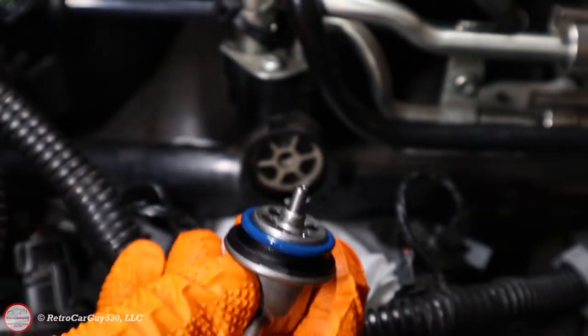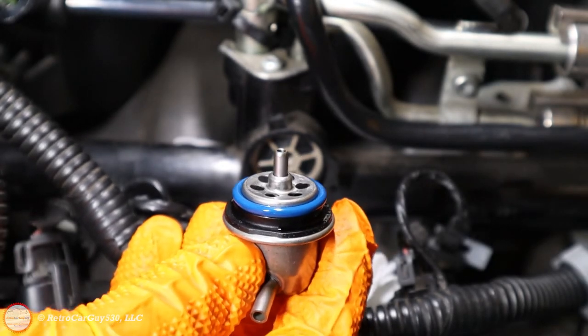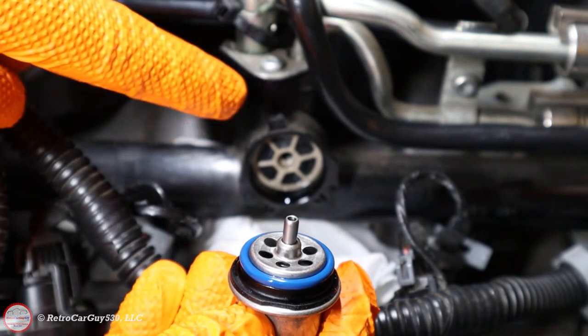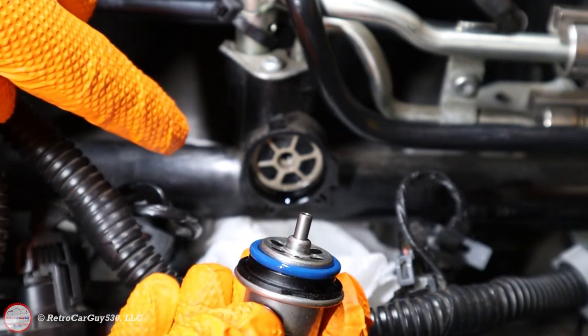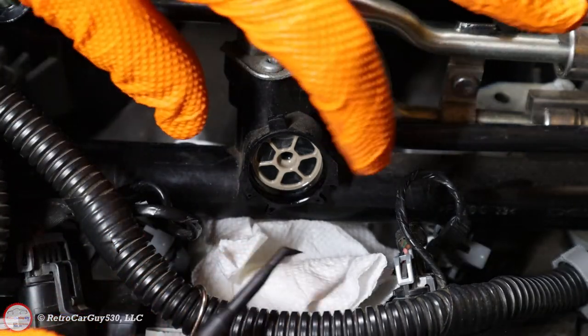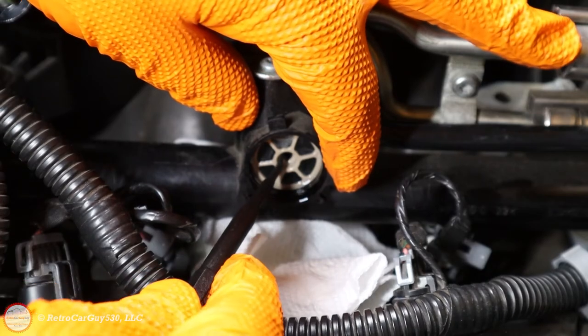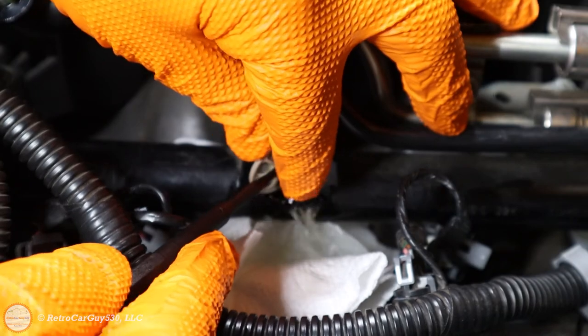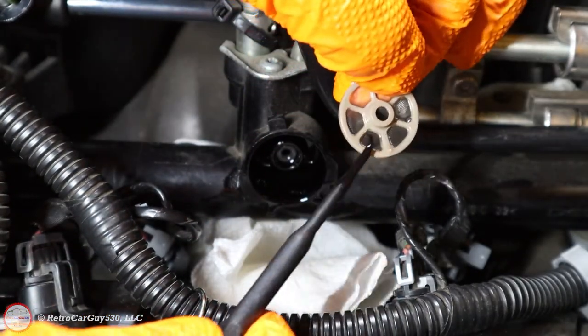There's the fuel pressure regulator — and here's the large o-ring. Notice the little o-ring is not attached to it, and part of the regulator also stayed inside, so we need to carefully bring that out. Setting this aside — since gasoline fumes are present, make sure you're in a well-ventilated area with fans going, cool environment, and no ignition sources nearby. I'm going to take a plastic or nylon pick tool and try to bring the remaining portion out without scratching anything. There's the plastic portion and we still don't have the o-ring.